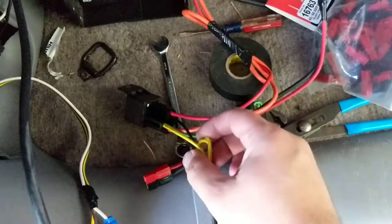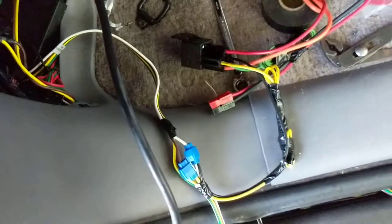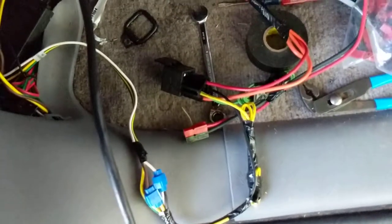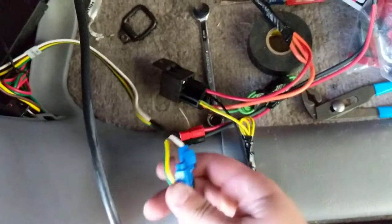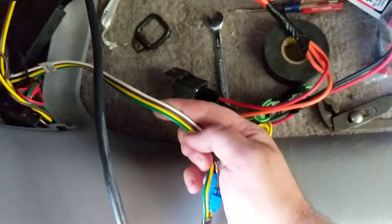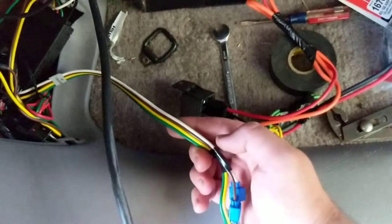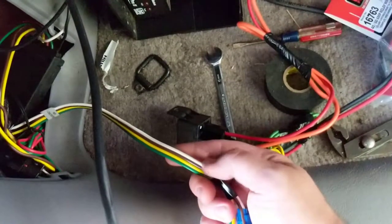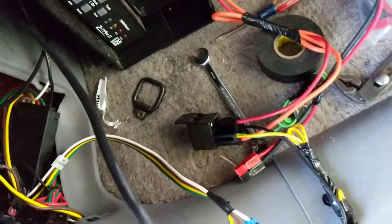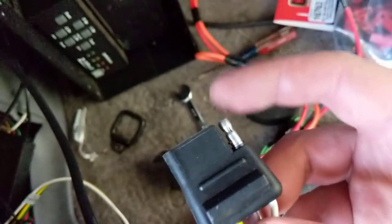My challenge was finding somewhere that made sense to connect the yellow wire that actually activates the relay. I'm going to call this 'Gerald rigging' — a slightly classier way to jerry-rig something. What I did was go to the wire that came off that T-connector kit for the flat 4 connection. Brown is the running lights or marker lights, white is the ground — that's a fairly universal standard, but check your pinout.